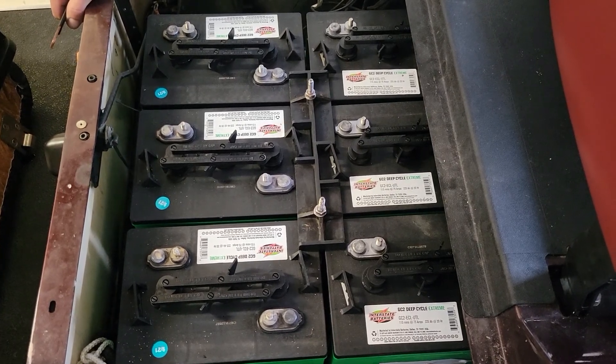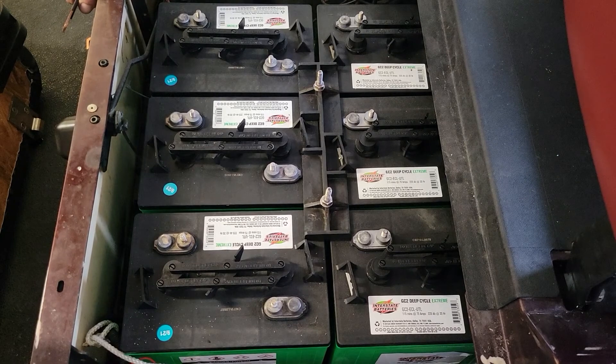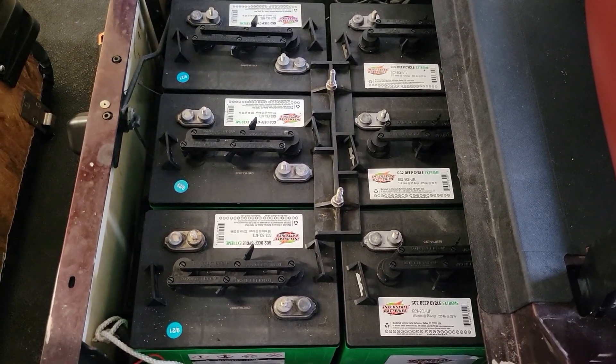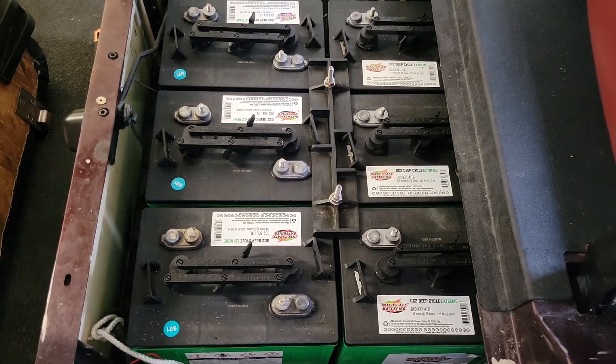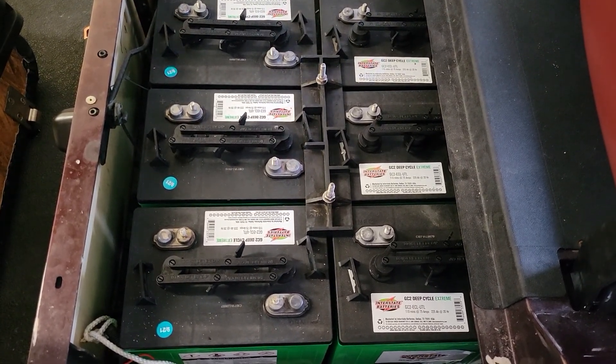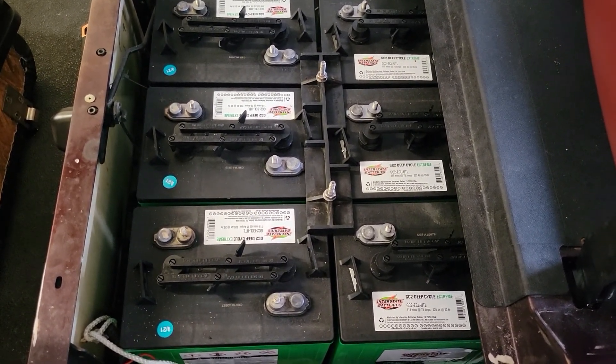The battery manufacturers have made the post so short that we're experiencing meltdown problems, because the little wiring that comes with the car or even the upgrade just doesn't transfer the heat or amperage — which equals heat — quite as well as a bus bar will. This technology comes from basically forklift batteries.